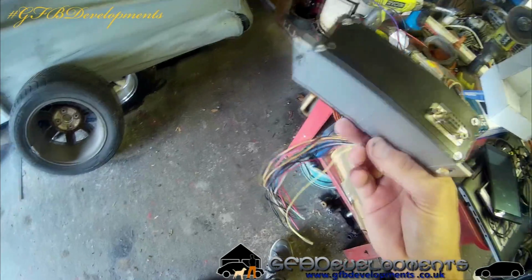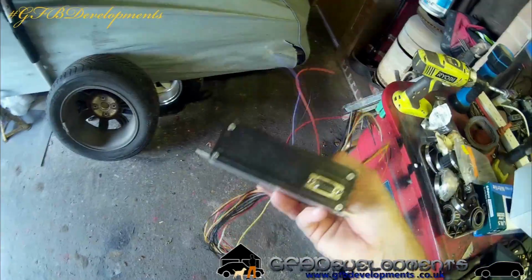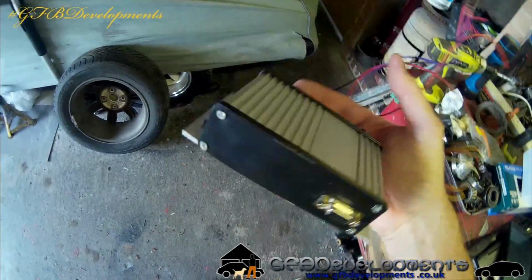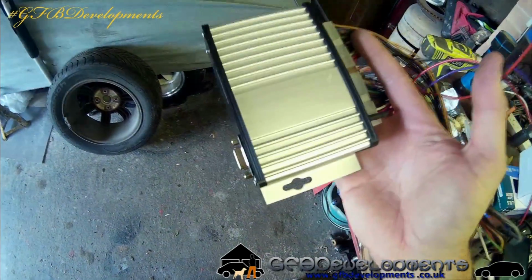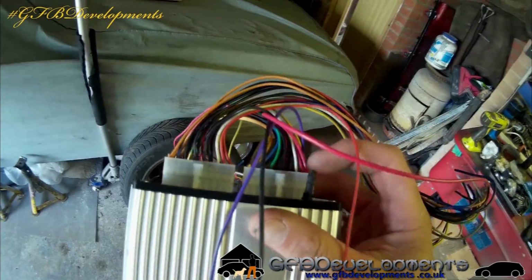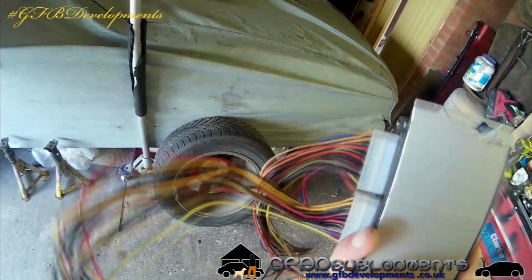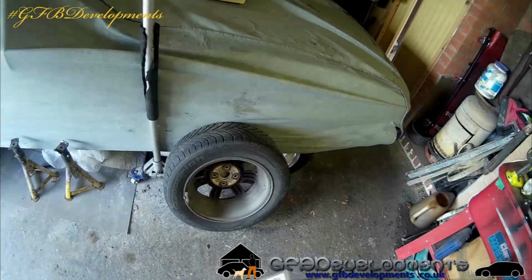I had it hooked up yesterday, making sure everything was working, that you take the firmware MS2 Enhanced, that you get the firmware, and also that it read the sensors. So what I did was keep it hooked up to the 12 volt feed and then plugged it into my car just to see if the map sensor would read anything, and it did. So I'm kind of alright that I think this thing will work fine.